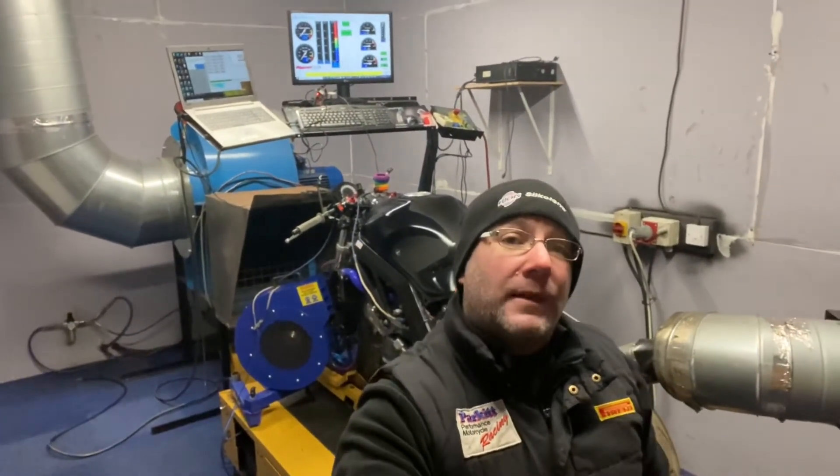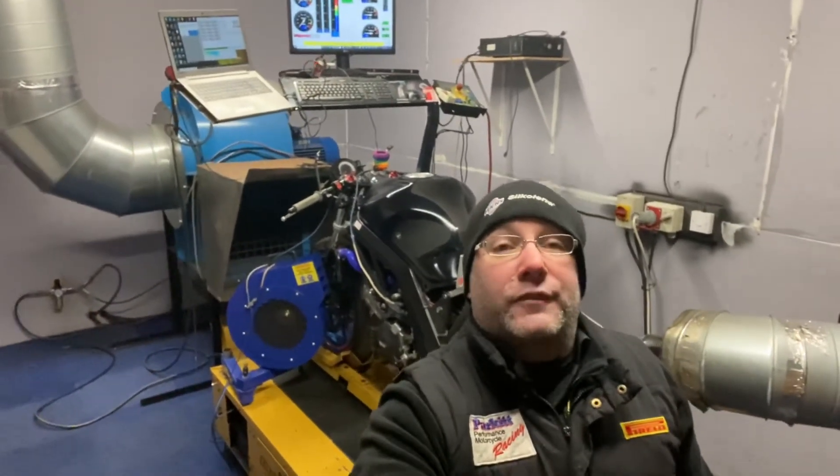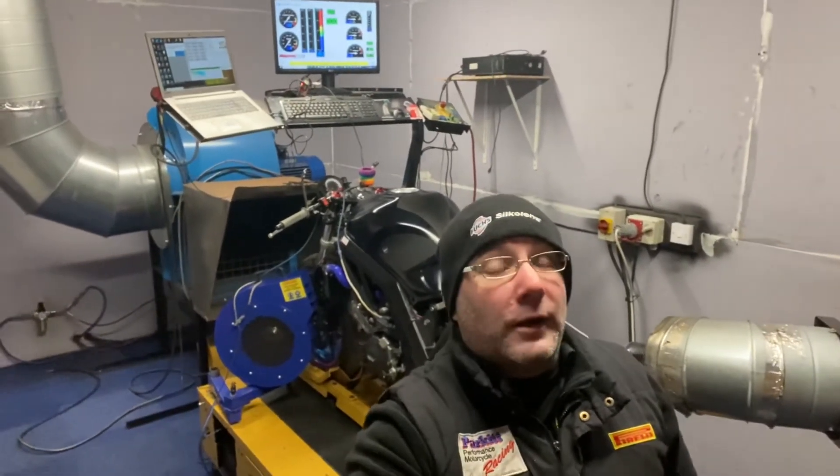We can do them in various RPM ranges which gets the bike where it needs to be. Cost is going to be lower — on average you're looking at £150 for a map, unless we do a bi-cylinder map, which we're going to be doing on this SV: a front cylinder map and a rear cylinder map. But it still comes out cheaper than an aftermarket fueling module, and you don't have all the associated wiring either.